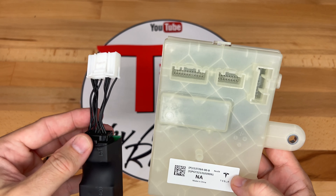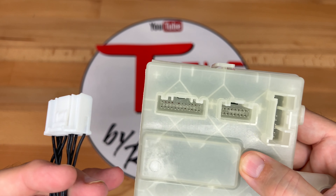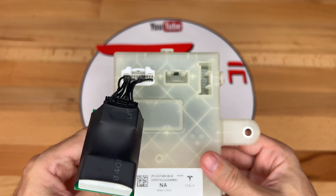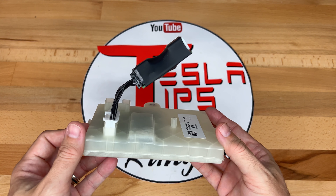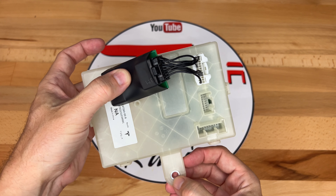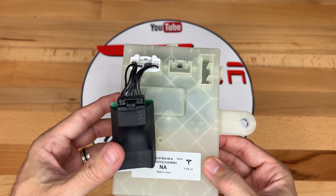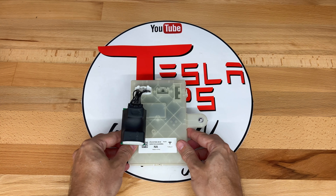At this point, I might as well connect the wire harness to the ECU. Take the male end of the plug and insert it into the far left connector on the ECU. The other end will attach to the wire connector in the car. I recommend reading the retrofit message thread to get a good idea of how this works before ordering the part. I'm not making any guarantees that this will work for you, and if you have any issues, you may need help from Tesla and it's not covered under warranty.